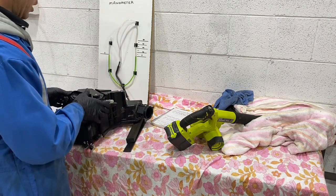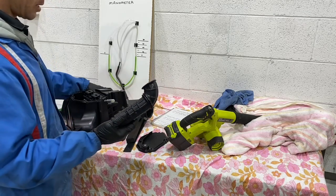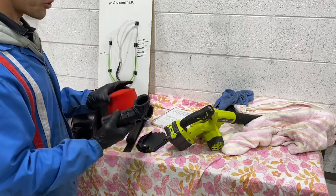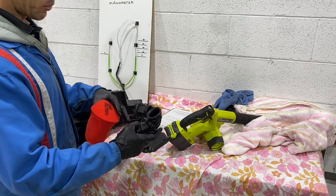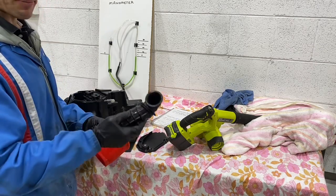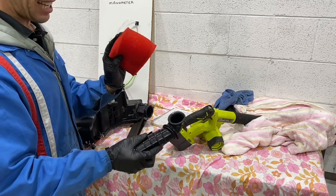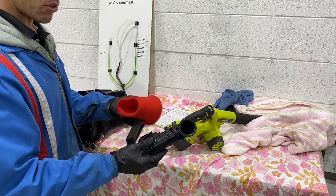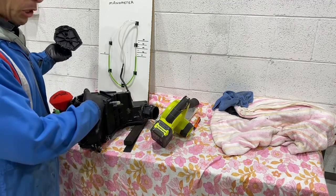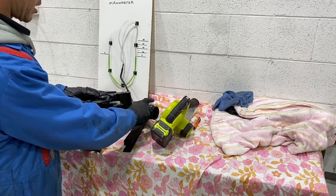So now what we're going to do is mimic the standard air tube with the air filter restriction into here. There's a new UniFilter kit out that puts a single boot inside this. So I'm going to put this restrictor back in and tape up the intake just to mimic the standard intake. And then I'm going to stuff the air filter inside, very similar to the way their sock sits in there, and see what restriction that actually comes up with. We have no air filter. We still have the CB high flow intake on the boot.